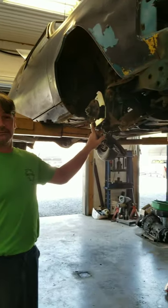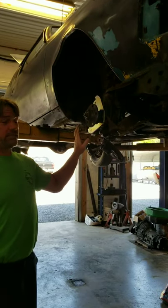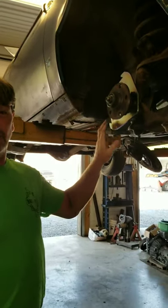Okay everybody, if you ever want to do a disc brake swap on an old car, you can go online and find guys who sell these brackets. You need to find the rotors and the calipers that they tell you to buy. In this case, it's a set of rotors off of a Toyota Previa and calipers off of a Chevy Celebrity.